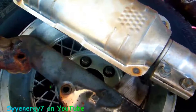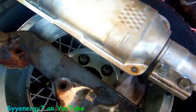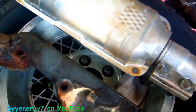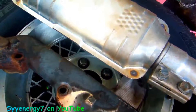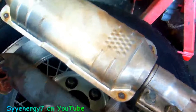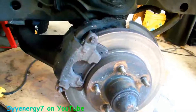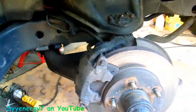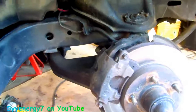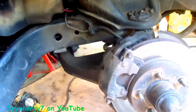Just touch it up with a rag, because it can rust from the inside. Usually it rusts more from the outside. Like I said, you can't find exhaust system parts for this thing too easily anymore. I also broke loose the caliper bleeder screws on here, changing the master cylinder — so it's got a lot of new parts on it. Still need some belts, hoses, probably a timing chain and fuel pump.